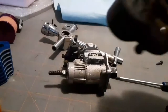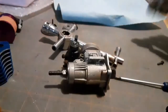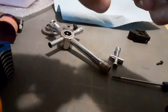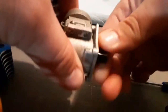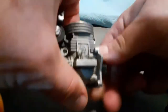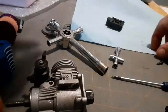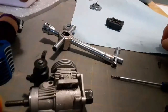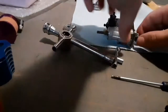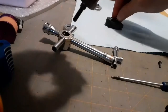How this starter works is that knob rides on the bearing on the back of the motor. This is a one-way bearing, so the pull starter — see how it frees one way and doesn't spin the motor, but the other way it spins the motor. That's how a one-way bearing works; it only spins in one direction. Pull the one-way bearing off and put it in the starter so you don't lose it.